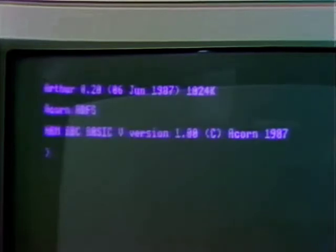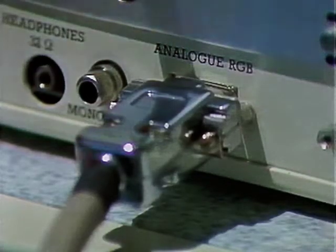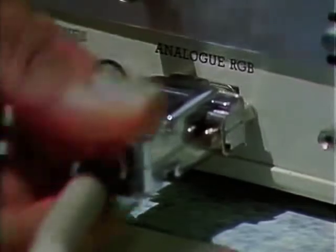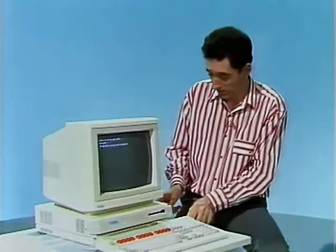There. Well, obviously I've done something physically to the machine, but I've managed to produce a fault which at first sight seems to suggest a monitor fault or a fault in the output somewhere. Some of the colours have gone. What I did, though, can happen quite easily. What was that? Well, the lead from the video was unscrewed and came loose. It's a very simply corrected problem once again. There we are. And not restricted to just Archimedes, of course.